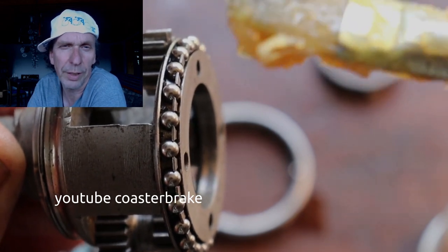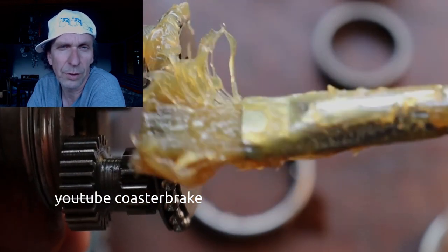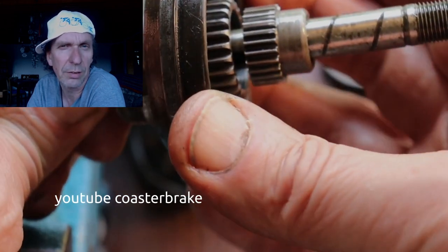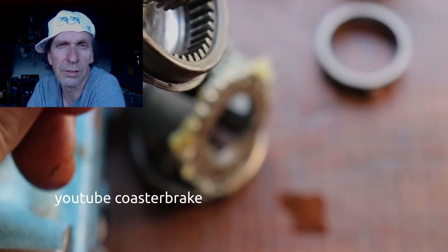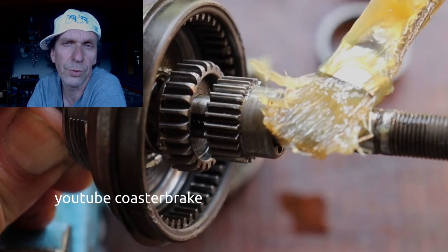This shows a planet wheel carrier, and I grease the ball bearing on it with normal grease, yellow grease, and for the rest I only use oil. Now, at the axle, I show it now. For the position of the planet wheel carrier, I also use grease.